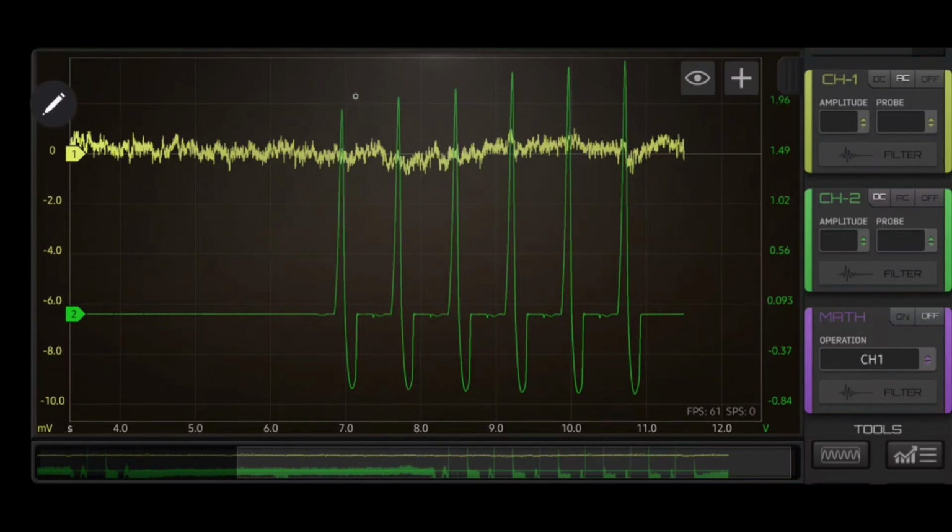And my voltage here on my pressure transducer is only at like 2 volts. And you've seen the other car, the Cadillac, it actually maxed out my gauge and had the flat tops to it. So this thing has like no compression, it has no intake pulls, and you can see how far down my exhaust valley is going compared to my compression. So this engine has major problems, and we ended up putting the manual gauge in it too, and this cylinder doesn't even move the compression gauge.